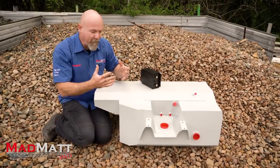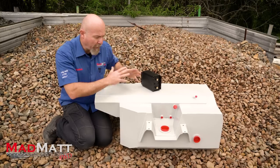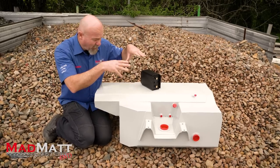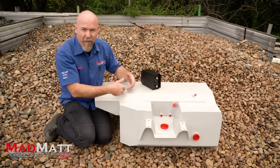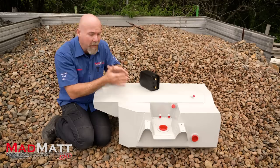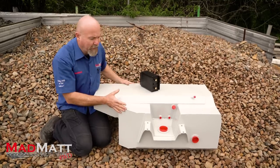That's going to allow for the differences in thermal expansion rates of the two dissimilar materials. It's also going to help stop any corrosion, and basically the hole in between those tanks is completely sealed so mud, grime, whatever can't get in and corrode anything or cause issues where those tanks come together. But they still have that little bit of flexibility and movement which they need for expansion, corrugations, rough roads, all that sort of thing.